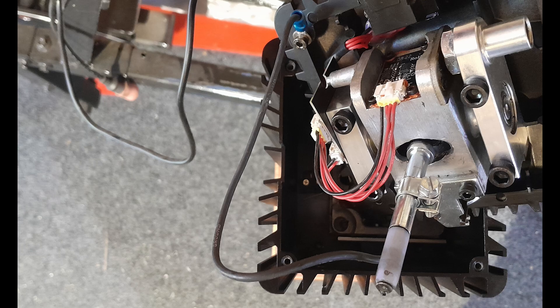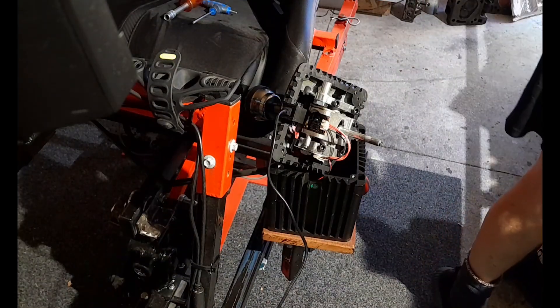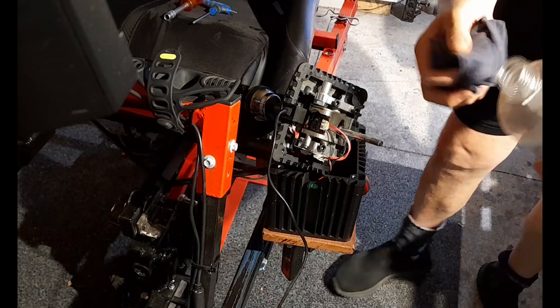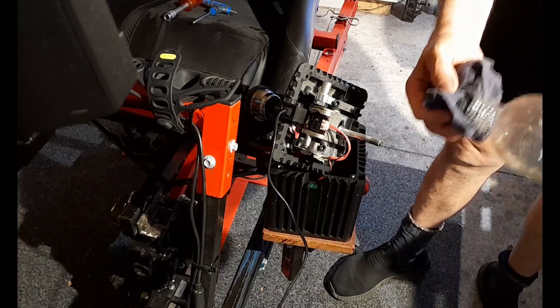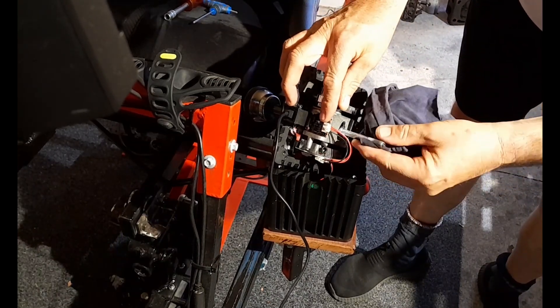Let me take you step by step through how to solve this issue. If you've tried everything and it hasn't worked, I promise you this will solve your problem permanently. The first thing to do is carefully remove the top of your shifter — remove the four little Allen key bolts that hold it on. Don't lift it up too high or you'll pull on the little connection from the top circuit board down to the bottom circuit board for the sequential shift. Place it just inside the shifter. Grab a clean cloth and get either some methylated spirits or rubbing alcohol — something that won't leave residue on the shaft but will get it clean. We want to get this shaft that protrudes through the bottom section of the shifter mechanism nice and clean, with no grease or dust.